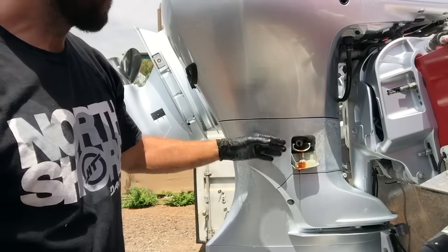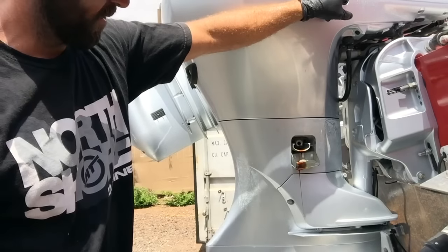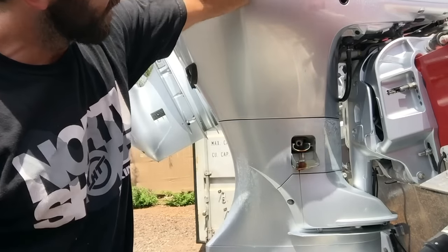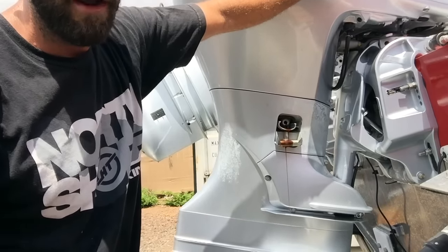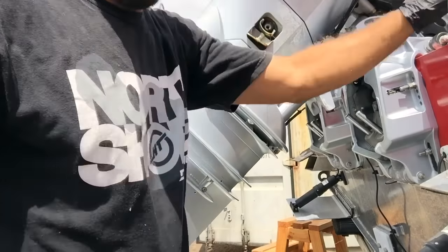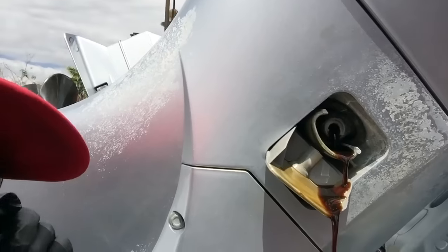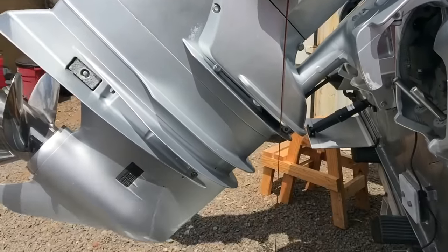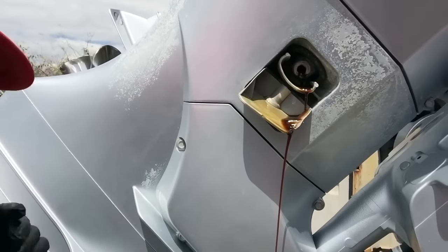Now that it's dripping pretty slowly, there are some areas inside this engine where the oil goes back and forth between areas. So I'm going to tilt it up until the drip is all the way at this edge. You're going to see it increase its drip just a little bit. The engine should be warm — I ran it about an hour ago to get all the salt water out. Look at all that extra oil coming out.